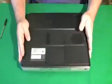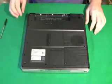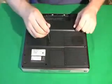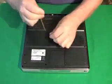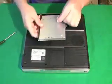The first thing I do is pull the battery out. You don't want to have any charge in the laptop when you're working on it. Second, I'll start pulling out components one by one — components that I can get to easily and that will be able to be removed so they're not connected to the motherboard.